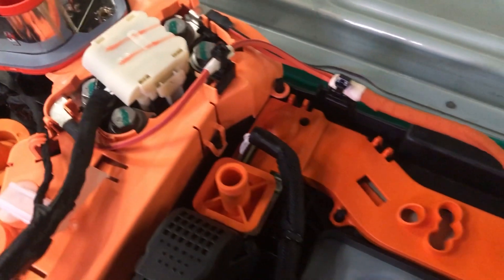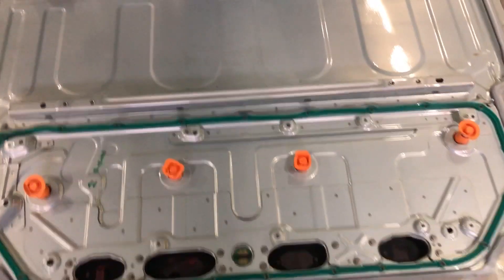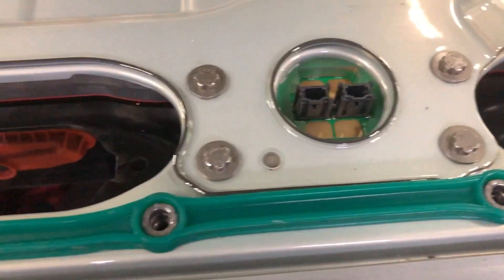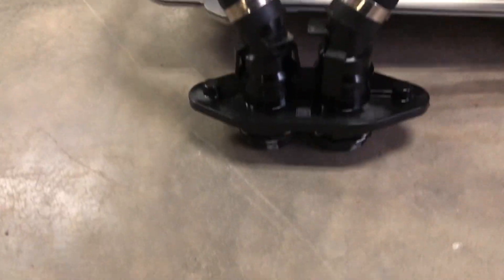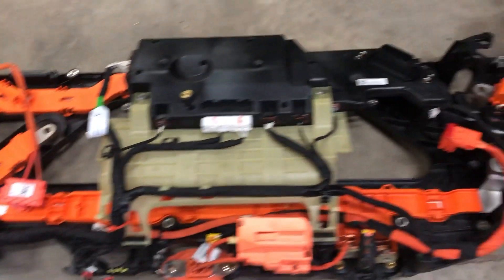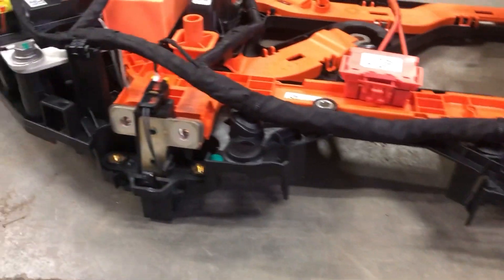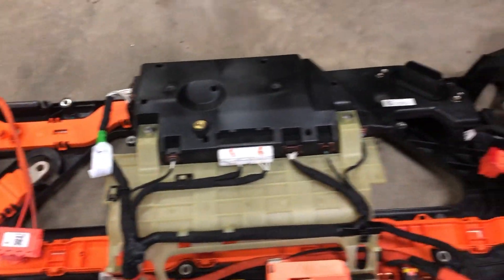Figure out the BMS connections and then we can start trying to get the top off of this thing. What a way better design than the Model 3. Those are the four studs poking up from the battery — that was the BMS connection. A very simple little two-wire, easy to access. Curious to see what's underneath that. That was the connection for the BMS coming up to the penthouse. Penthouse stripped out, there's the charger lying there. New cooling header that just snaps into place — real slick. That is the entire assembly for the penthouse — it all comes out in one shot. This is a much better design. They certainly made it much more serviceable, even though it's not considered serviceable. I appreciate that.